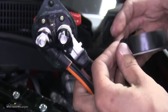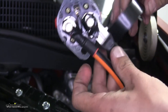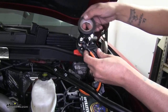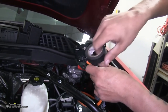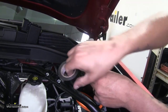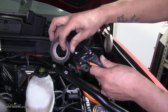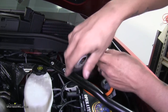Since we do have a little bit of metal exposed, I'm going to wrap around the cables and then the entire bottom of the terminal itself as well. Just make sure you cover any metal components with electrical tape or heat shrink, because if something were to break or somebody forgets a wrench underneath the hood, we're not going to have to worry about any shorts or any kind of electrical issues.